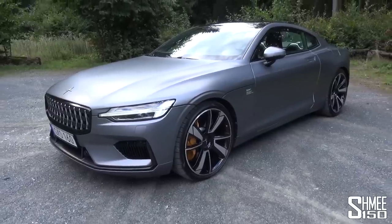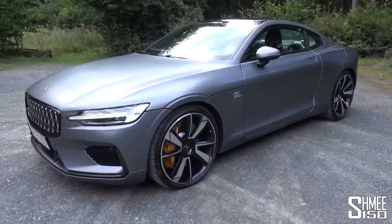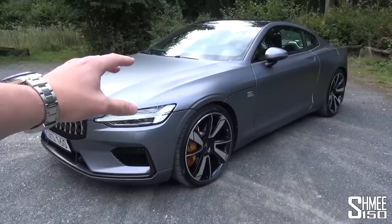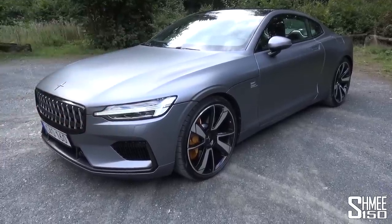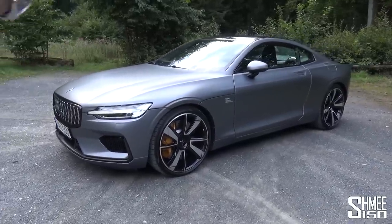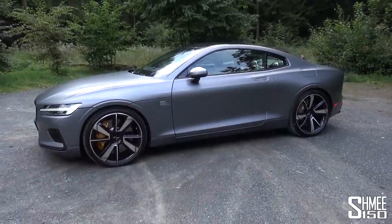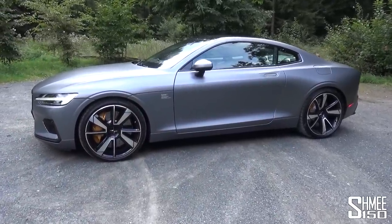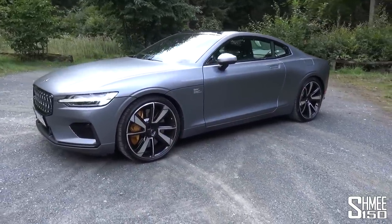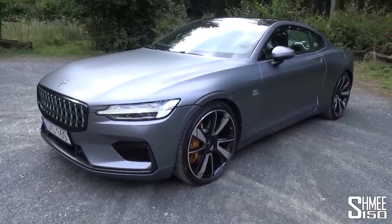It also has this hybrid setup, which is a particularly confusing powertrain. But let me try and explain a little bit of what this actually has that makes it all work. So up front, you have a 2-litre four-cylinder engine that is both turbocharged and supercharged, the engine from the T8 version of the XC90, but that's also combined with an ISG, an electric motor, attached to the engine up front. Then at the rear, you also have an additional 2 electric motors offering direct power and torque vectoring to the rear axle, and the ability, of course, to put down the power very quickly thanks to having a 34 kilowatt battery setup to give you, well, all of that electric range as well.